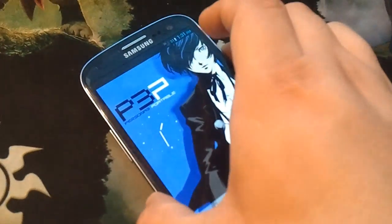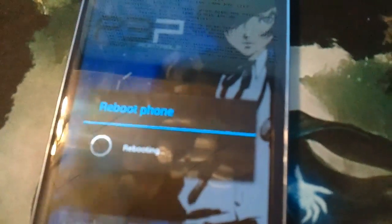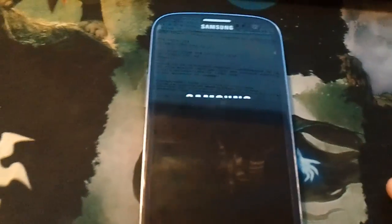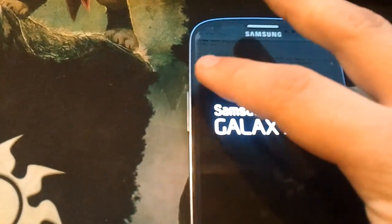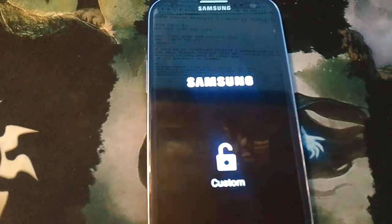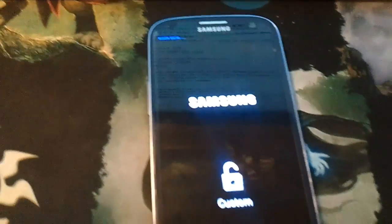Some people want to know what the reboot process is like, so we're going to go ahead and reboot the phone. When you reboot into CM9 and CM10 on the Verizon variant, because it uses Kexec, what you end up having is it boots normally. It'll show the Galaxy S3 splash, then turn off, turn back on, and boot into recovery. At that point it should show the little Android guy flashing something, and then around a quarter through that, it turns off and turns back on. Then you should get the CM9 boot animation, as CM10 doesn't have one yet.